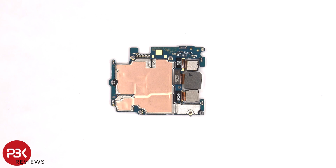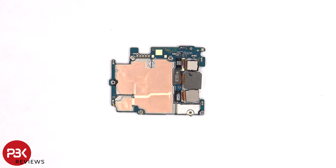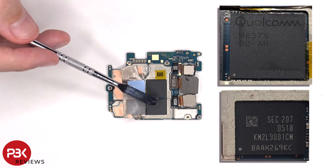Looking at the back side of the motherboard we can see the connectors for the cameras which can be disconnected by just popping them off. The proximity sensor is located on top and next to that is the notification LED. There's also copper tape on the back shields to help transfer heat, and these pins over here make a connection with the flex cable for the headphone jack. Once the copper tape is peeled back we can see thermal pads on top of the processor and RAM.